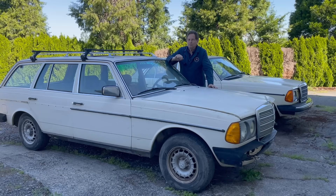From yesterday, I wasn't too happy with the sound of the engine, but I'm not giving up hope yet. Today I'm going to hook up a remote emergency tank and put some diesel purge in it and run the engine again. If you've followed me over the years, you know I use diesel purge as a troubleshooting liquid. When you put diesel purge directly into the injection system of these old diesels, if the injection system is healthy, it should quiet things down — a lot of noise comes from the nailing of the fuel injectors, and diesel purge has more lubrication.